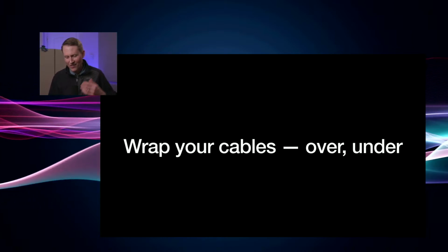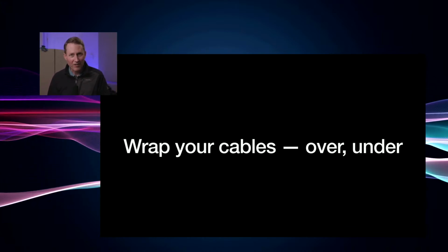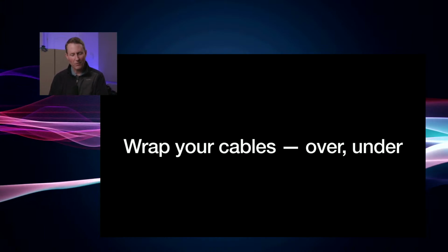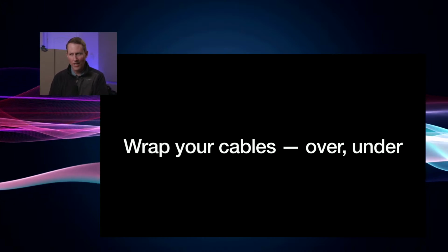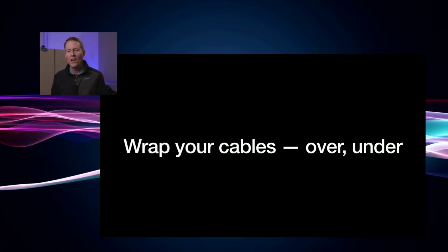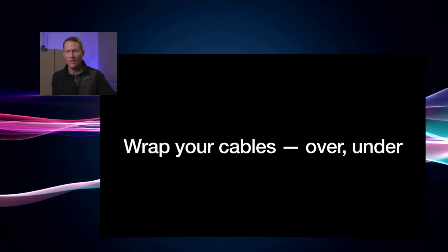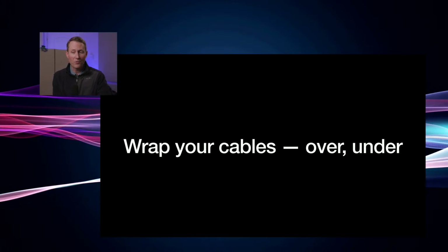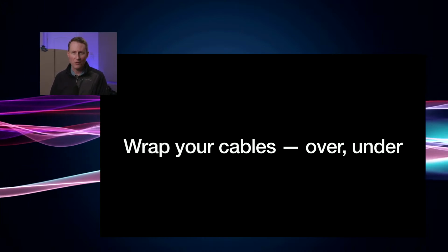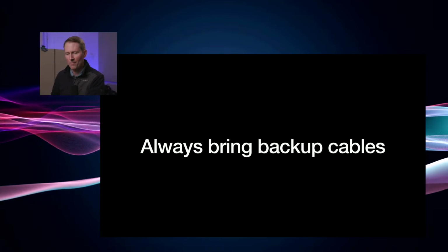and at one point he said, "Curtis, I'm getting this hum, and I cannot figure it out. I've spent all this money on a MixPre. I've got this great microphone. What's going on?" And we did a little bit of troubleshooting. We dug into things. It turns out he was using Amazon Basics cables, and he had them routed down behind his desk with a bunch of AC adapters. Once we switched him to some higher quality cables, I think he ended up with some Mogamis, and I did suggest that he move away from the AC adapters as well, once he got those new cables and reset everything up, he had no problems. So definitely something to keep in mind.